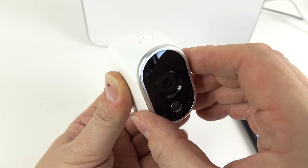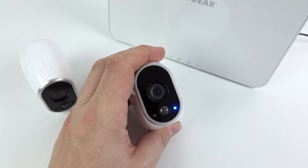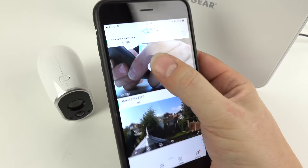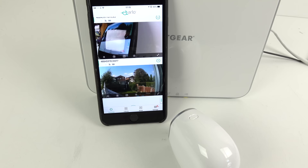Let's get these cameras synced up with the base station. The first step is to hold down the sync button on the top of the camera itself — you get a blue flashing light. You then go to the base station and hold the sync button on that. You get a quick flashing orange light on the camera, and a rapidly flashing blue one, which indicates the camera is now synced to the base station. Once the camera's in normal operation, those LEDs aren't lit. I've got both cameras synced up now, so let's just have a look at them in action. I've pressed to go live — the cameras aren't live until you press that button; they're in low power mode. I've got a live video in one, and I've put the other camera on the windowsill, and we can see both cameras live at the same time in the same app.